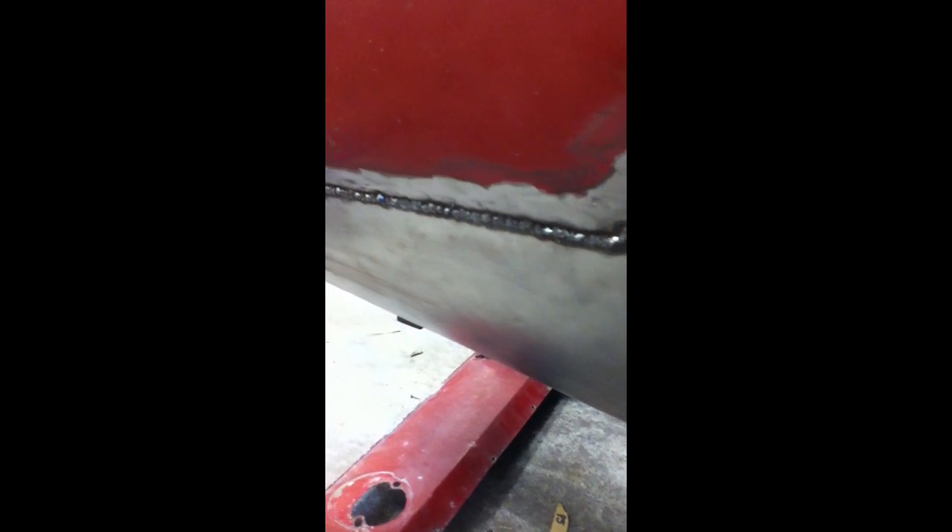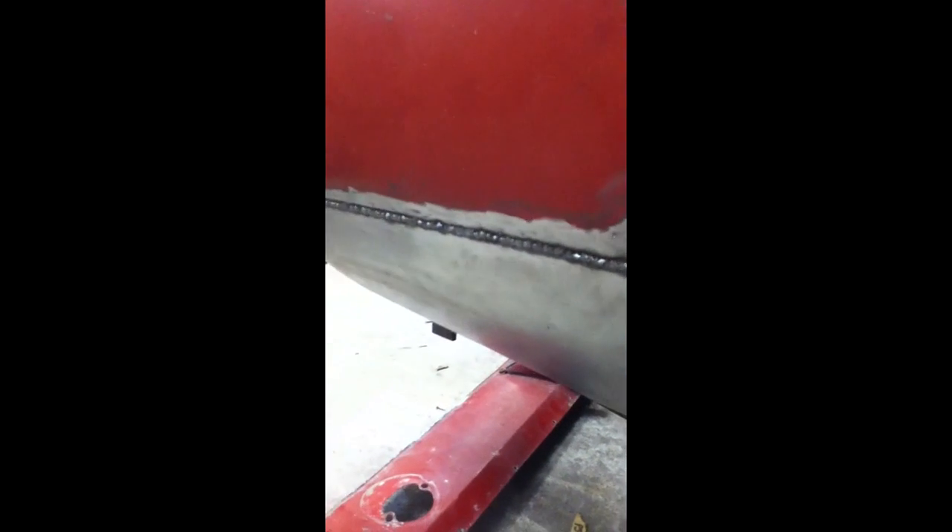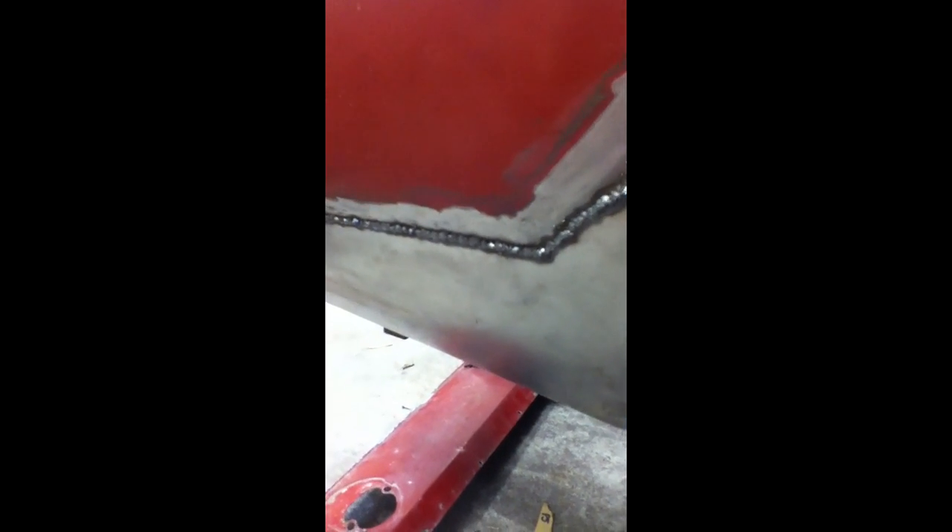Here's the inner piece. Instead of flanging the rest of the body, I went ahead and flanged the new piece that's going on because it gives it a better look on the inner quarter panel, and because of the weakness and years of abuse this took, I would have had a major blowthrough if I tried to butt weld it. I prefer to always flange the body because you get way more control — you get a lot more cleanliness, a better look, a better weld, and overall it makes it a lot easier and less time consuming.